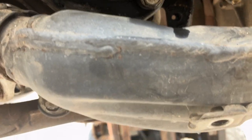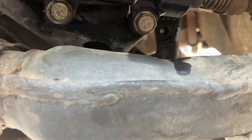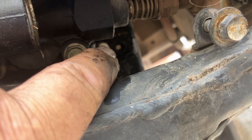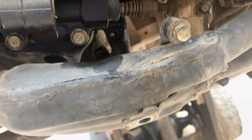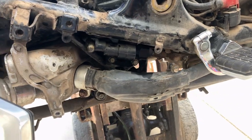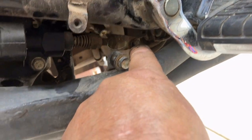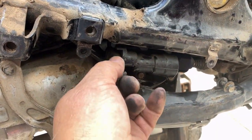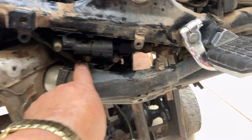It looks like we're able to get to it without removing the exhaust. Basically there's a little screw right down in there — you can sneak a long extension between the exhaust pipe and that shield. It holds both of those little shields on. If you pull that screw off, you'll be able to get the shielding off, then get to these two screws here and be able to pull the c-clip right here on the cylinder. We've already taken off this line here.